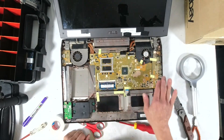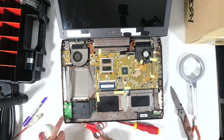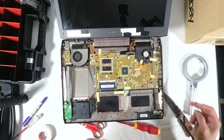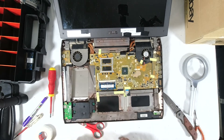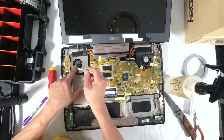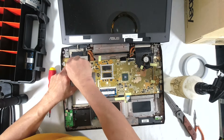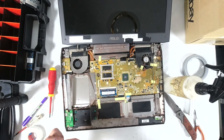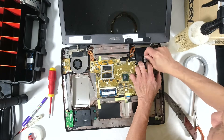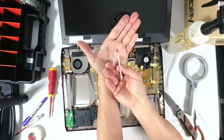The fans, the motherboard, ethernet connector, USB, USB, microphone, earphone jack, VGA, power input socket, HDMI, USB, USB, USB. I think I'll give this an isopropyl alcohol clean. The fan blades are very dusty — I'll give them isopropyl alcohol treatment. With the cotton earbud you're guaranteed to take maximum dirt out. It's a slow process — you've got to get the earbud with the alcohol into those blades. See how dirty they are.